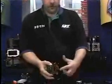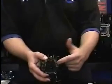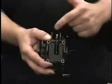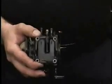First, we have three fittings. We have a pulse fitting, which leads from the crankcase of the engine. We have the fuel inlet fitting, which allows fuel into the carburetor. And we have the fuel outlet fitting, which allows excess fuel back to the fuel tank.